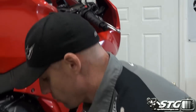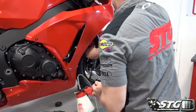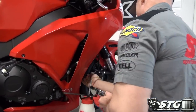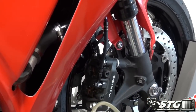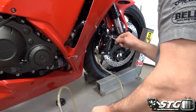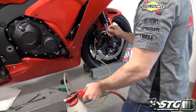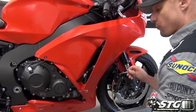We're going to come down to the brake bleeder screws and draw all the fluid out from the bleeder screw, the hose, and the caliper using the same tool. If we do this just right, this whole process should be really clean. When we come back, I will have already done the other side and we're going to go ahead and begin removing our brake lines.